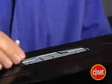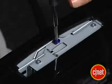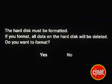Now slip the new drive into the bay that we took the old one out of, then slide it to the left until you hear a click. You'll know that it's in the slot it's supposed to be. Then put the blue screw back in place to lock the drive where it should be. Finally, put the bay cover back on, then attach all of your cables, and you can start up your system. Follow the on-screen instructions to format and set up the drive.